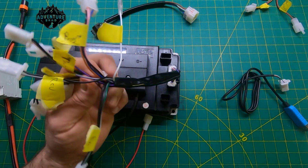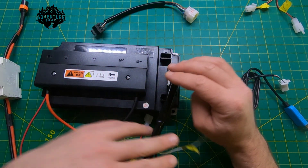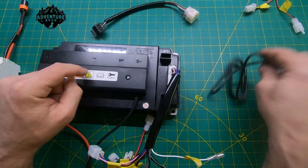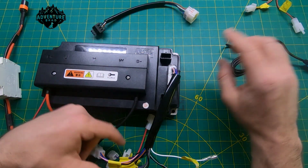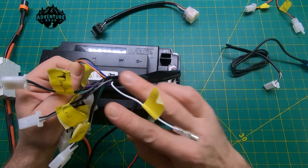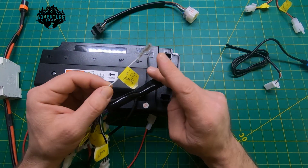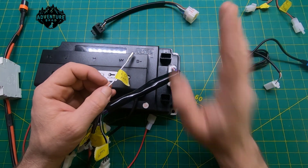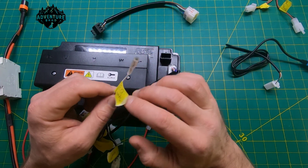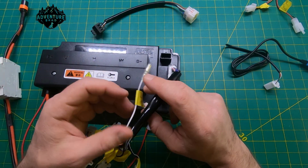In this wiring loom, I'm showing it all stock. The white one is the speedo or line cable. If you have the CAN version — it'll say 'CAN' under the cover near the date and serial number — you'll want the programmer and a CAN display. For the non-CAN version, hook the line cable through your display. You have to power the display and the controller up together so they synchronize and talk to each other. Then connect battery positive and ground to your display and it will work.